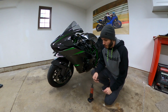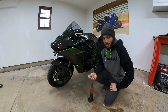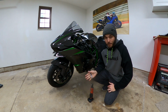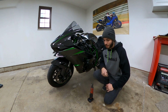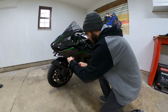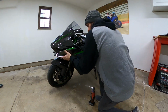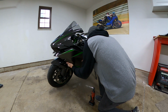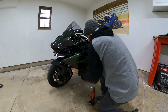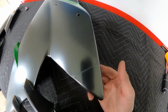Pretty well same story as the other side. Just have your 5mm, your 3mm, take all these out, take your one little pop underneath there, your little plastic rivet, whatever you wanna call it. This whole thing will come off. Now there are 2 wires you unplug, and then it's the same deal as the other side. Pretty easy. Easy peasy.